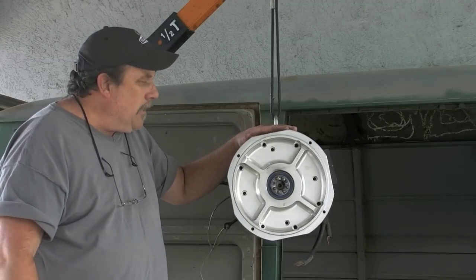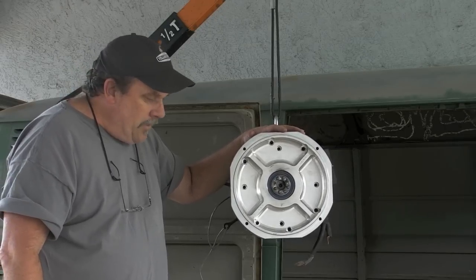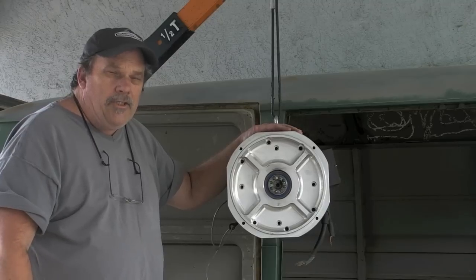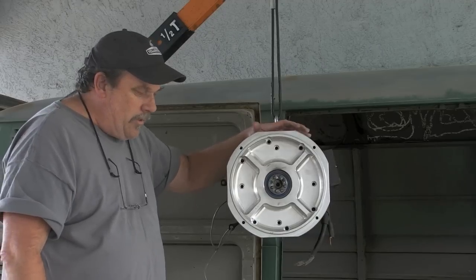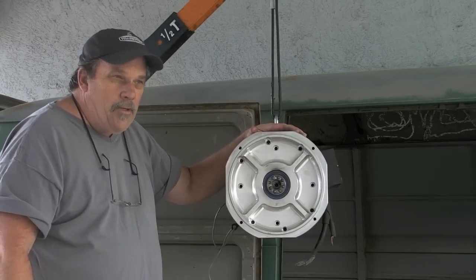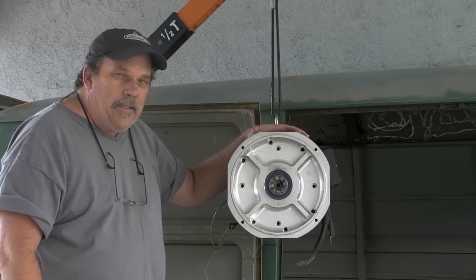Light flywheel, standard clutch disc with springs. I didn't have any trouble with the GE motor in my Karmann Ghia with a stock clutch. This one is a lot stiffer than stock — it's a 2,100-pound pressure plate. Anyway, that's it, until next time.